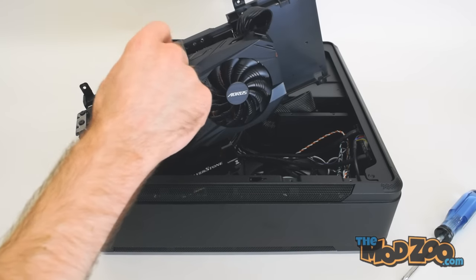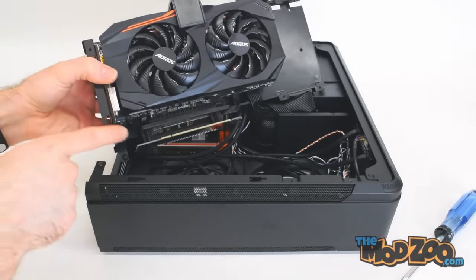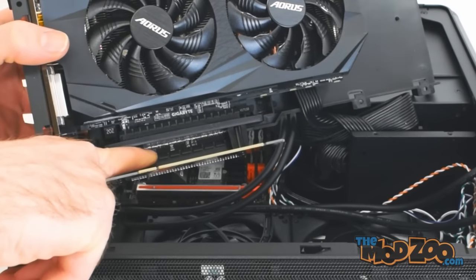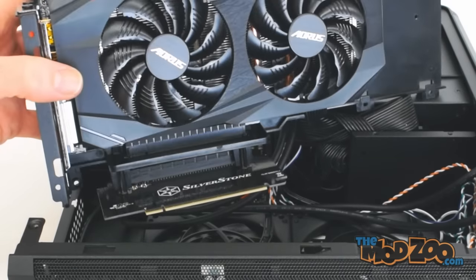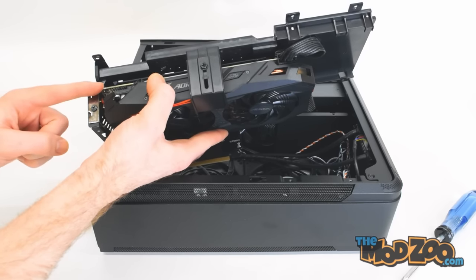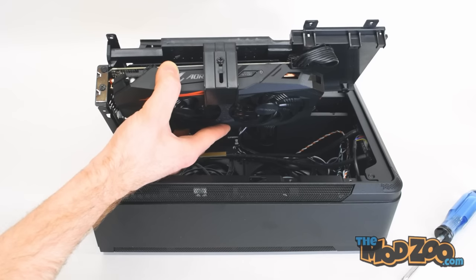A graphics card up to 13 inches long (330 millimeters) should fit. The standard width in this direction is 4.38 inches (111 millimeters) — that should be fine. With the graphics card holder you can go up to 5.16 inches (131 millimeters) before running into it. Without the support you can go up to 149 millimeters tall, roughly 5.88 inches. So you can fit an awful lot of graphics card in this if you really want to, but you may have to stop using that support bracket.